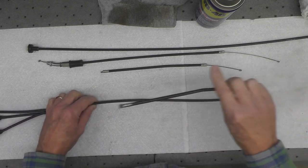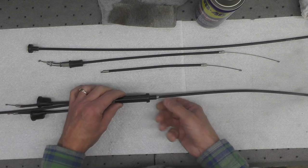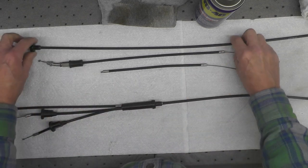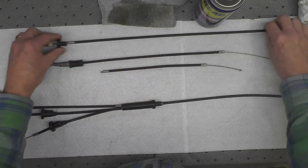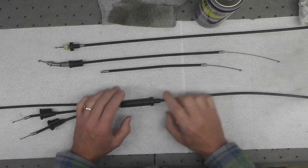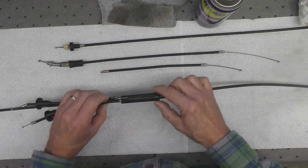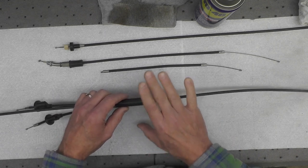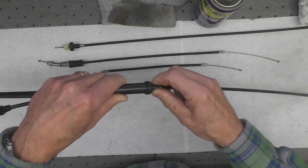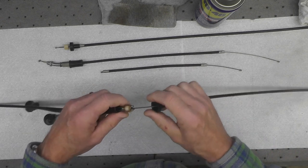Remember that three of these four cables are going to be replaced. We are going to start with replacing the main cable that comes down from the twist grip — that is the longer of the four, the one that comes into one end of the junction box. I am going to attempt to separate these two components because the new cable has the cap built into it. Usually you can just snap these open or pop them apart, though sometimes they can be a little bit difficult — this is plastic, so you do have to be careful. And this one is already kind of loose, so I am expecting it is going to just pop open. And that is about as easy as it gets.